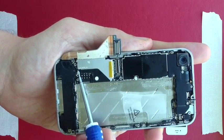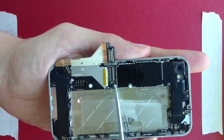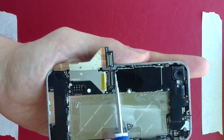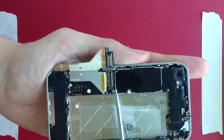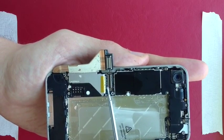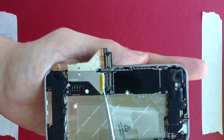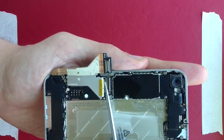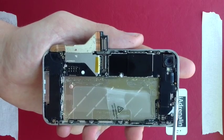Make sure you don't break that little piece off. Also be very careful around here — you'll see there are a lot of really small, half-millimeter by one-millimeter jumpers along the motherboard. They connect circuitry together, so try not to break them. If you press down on the motherboard while prying you can snap them off very easily, at which point things get very messy and you've probably broken your phone. So be very careful around all these micro-soldered jumpers.